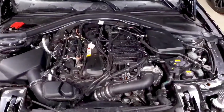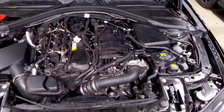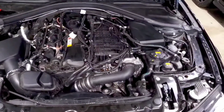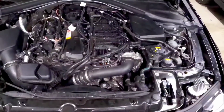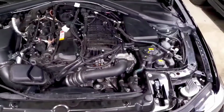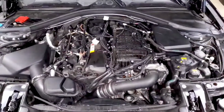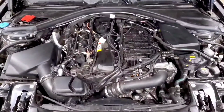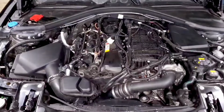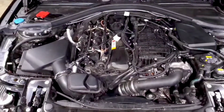That being said, you can easily get to 120 to 140 miles an hour doing a pull in that high of a gear. So if you're not comfortable doing that, you can try to do it in a lower gear and just try to make the best of it. But the longer the gear is, the higher the speed it gets to, the more data you'll get. But make sure you don't do it in too high of a gear where it's past the 1-to-1 ratio. Like on the manual, don't go above 5th gear, and on the ZF8, don't go above 6th gear when you're doing a logging pull.